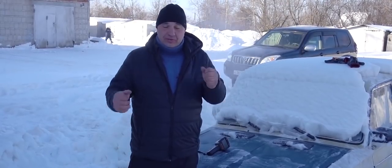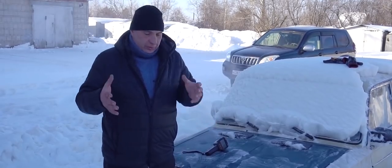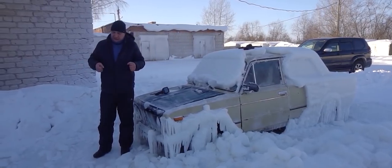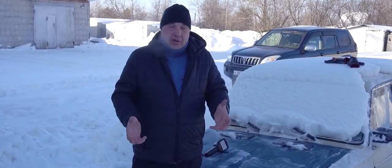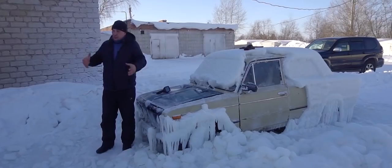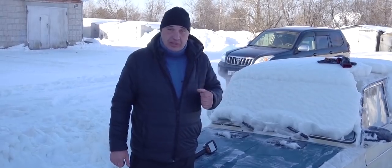Anyway, you guys saw the battery for yourselves, okay? I was actually quite surprised to see that after about 3 days, upon opening the lid and having a look with a thermal camera, even though the battery did get pretty cold, the engine bay got down to minus 35, while the battery stayed at minus 17, which started falling right away down to about minus 22, until we stopped. Maybe it was minus 24. So yeah, fellas, thermal casing is quite useful.